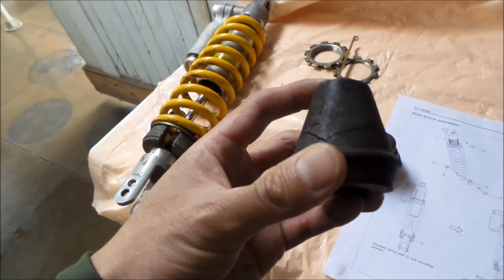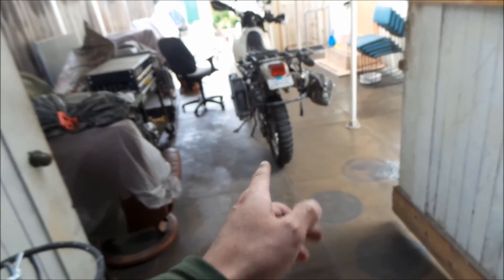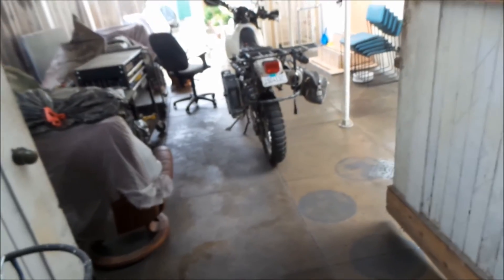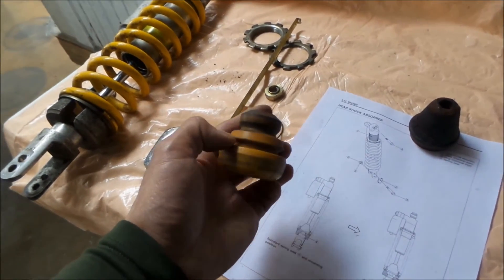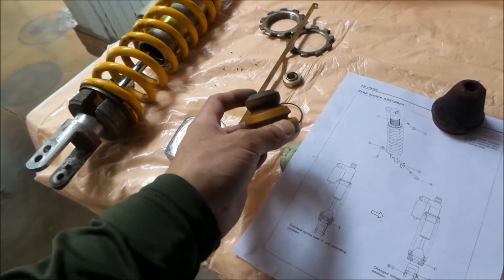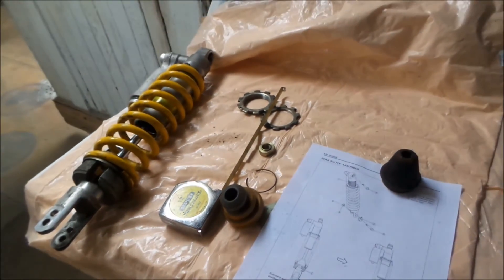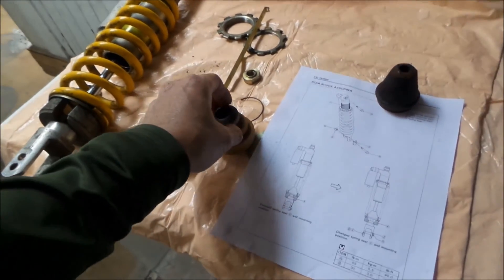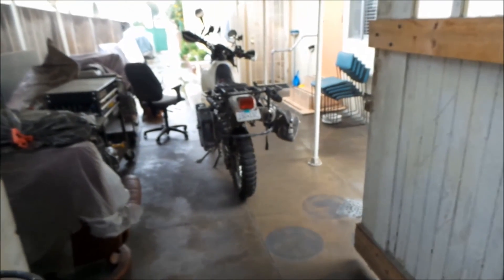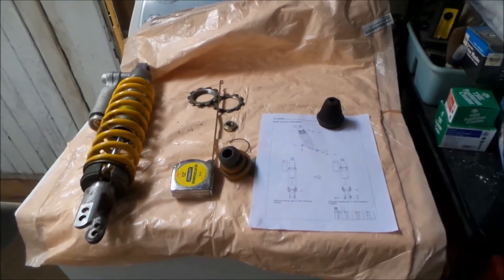That's interesting about cutting the bump stop too — you'd really have to measure how much your wheel is traveling. You can cut the bump stop to get more travel, but you want it to bottom out too. The bump stop and bottoming out is a safety measure to keep your bike from destroying itself. Alright, I hope you learned something. Hades Omega out.